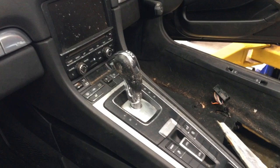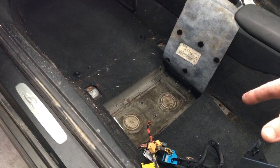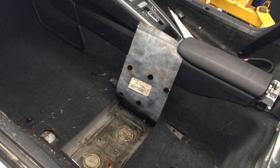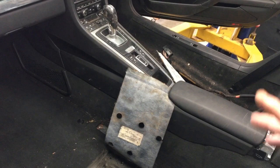Basically, what I needed to do before I put any power to it — I removed the control units down here at the bottom, which I knew were going to be absolutely ruined, and just so it didn't short out the whole car I got that wiring to the side. Because the battery was completely toasted, I put my charger in power mode and just charged the thing up. The alarm went wild but eventually it settled down. It gave me a whole bunch of warnings on the MFD that it had system faults — obviously because I'd removed a bunch of stuff. But I was actually able to get the key out, put it back in again. Everything actually seems pretty reasonable. The screen came on, the air conditioning controller display came on. So hopefully I'll actually be able to get a car out of this that might actually go.